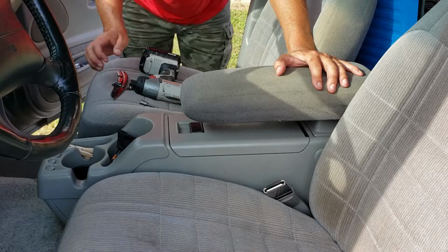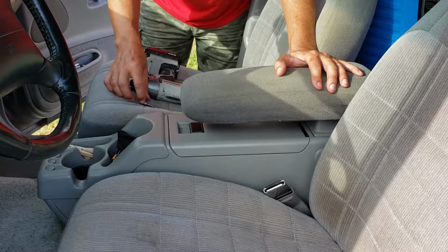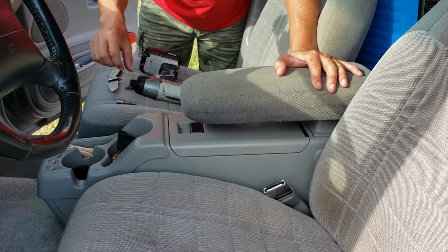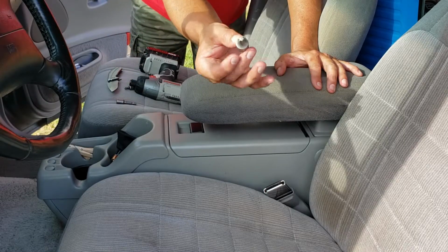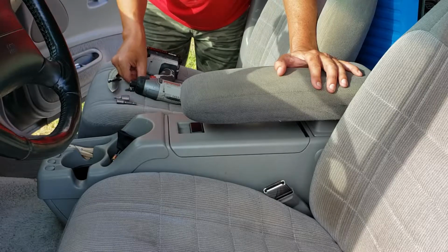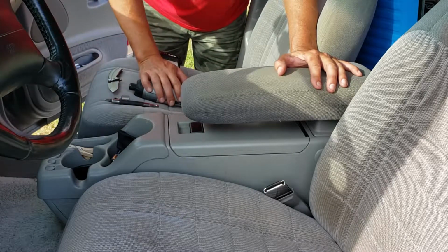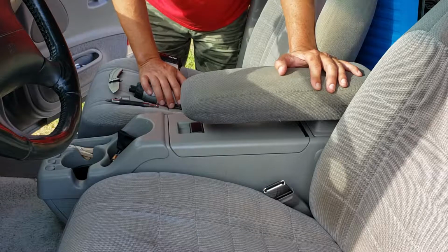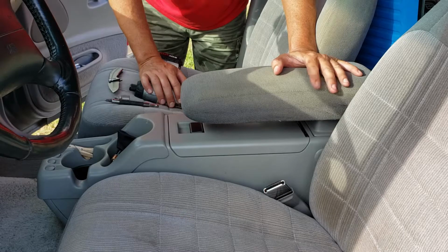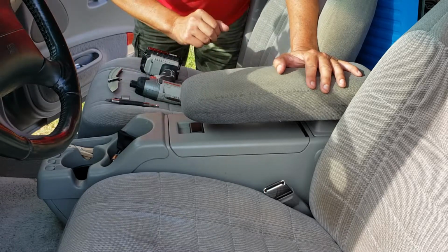What you'll need for this job is a knife or a screwdriver to do some prying with, a 5/16 socket, a T45 Torx bit, and a Phillips head screwdriver. An impact drill or wrench would really come in handy for that Torx bit, because it's in there pretty good. They have Loctite on them, so that'll come in pretty handy.